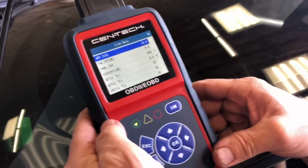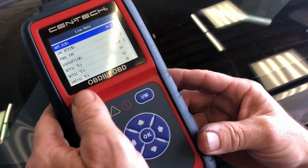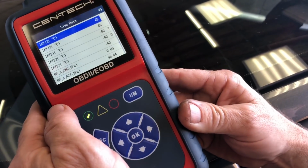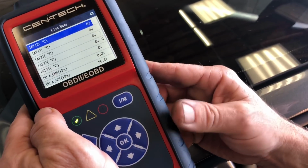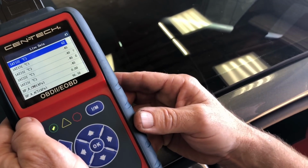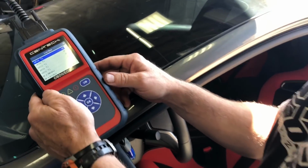So what we found in testing a lot of these is that the intercooler is barely adequate. Intake air temp 1 is in the mass airflow sensor, so that's picking up the air before it goes into the turbo. And then we look at intake air temp 2, which is in the manifold like everybody's used to. So that's obviously after the intercooler and the turbocharger, all that. But just sitting here after a run, it's been a good 2 minutes, we've got a 30 degrees C differential. And that's what kills us, is this one. That's crazy. So a 30 degree difference after one run. That's crazy.